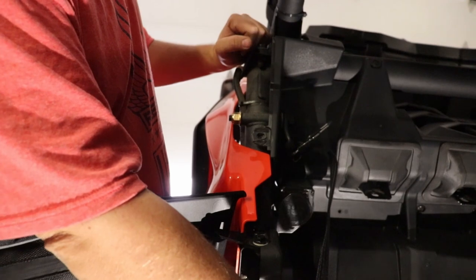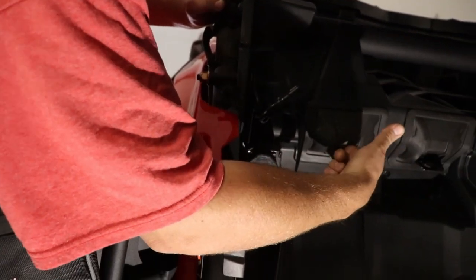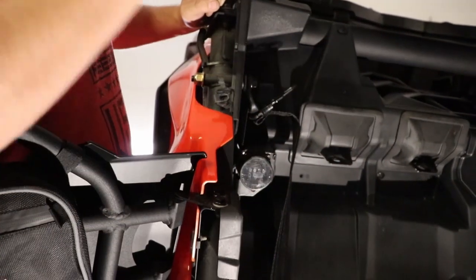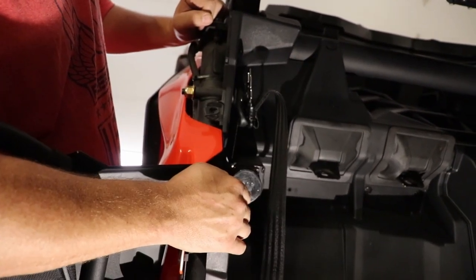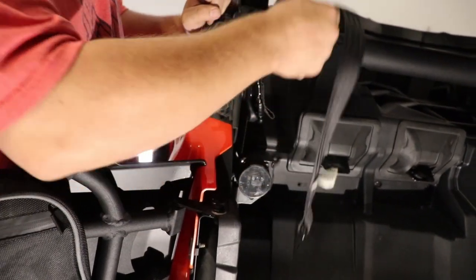We can go ahead and put the seat back in, bolt it in place, and get the final two four-point harness straps right here bolted in place, and that'll be it. And then we're gonna do the rest for the other seats. And then just save these parts when you take the seatbelt, all the stuff that goes with it, I'd keep in a box somewhere. So let me get the tools ready and we'll start this.